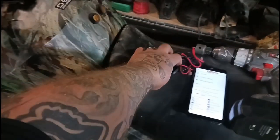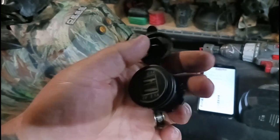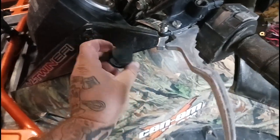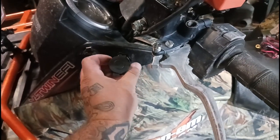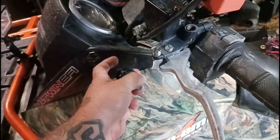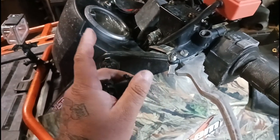So what I'm doing today, I'm actually going to install a secondary plug with built-in dual USBs. I'm going to use a hole saw of the same size to go in behind the original 12 volt plug and tap into the original power source. These don't draw that much power just to charge a cell phone, and I rarely ever use that plug, so I don't think it'll be an issue. I could theoretically just switch it out, but I'd want to keep that original there for the air pump.